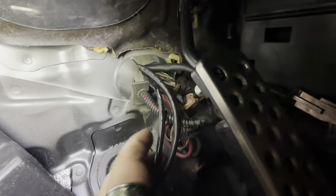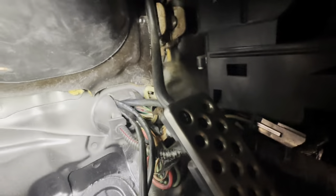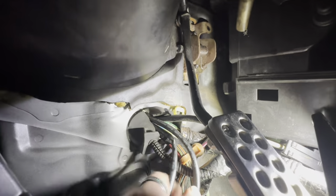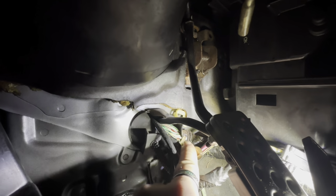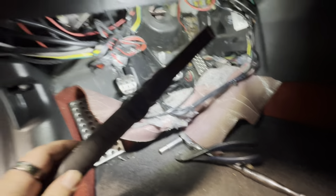I'm just pulling all this through — these are all the wires that you just saw on the other side. The main harness is this right here — that's the main harness on the right and you just got to pull it through whichever way you want. I'm still trying to figure out which way I want to go, but these I'm definitely pulling inside the car. This is for my electric steering — and that big one, that's the main fuse box harness. You just got to pull that black piece off with the 10 mil and then you can get access to your harness.